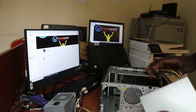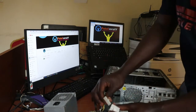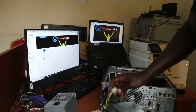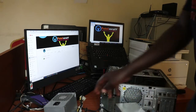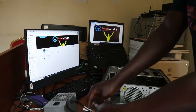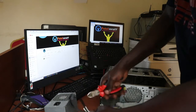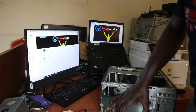Remember, we have to look at the specifications and ensure the pins are similar to the old one. Mine here — the old one has similar pins. Let me confirm: one, two, three, four, five, six, seven — that's 14 pins. Remember, I had to do this before making the purchase — check the model number and the connectors. I have two main connectors, plus this one which was connected to the power drive. I need to get it off the old one and tie it back to the unit.